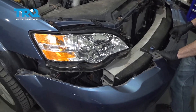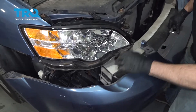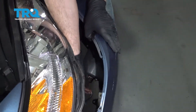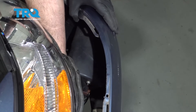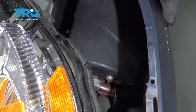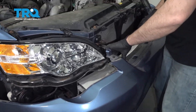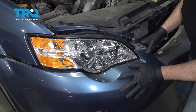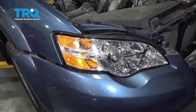Go ahead and bring our bumper back into place. Grab our fog light, line that up into the back of the lamp assembly, and twist that in. Repeat for the other side. Bring that bumper up and into the notch underneath the headlamp. Do the same on the driver's side.